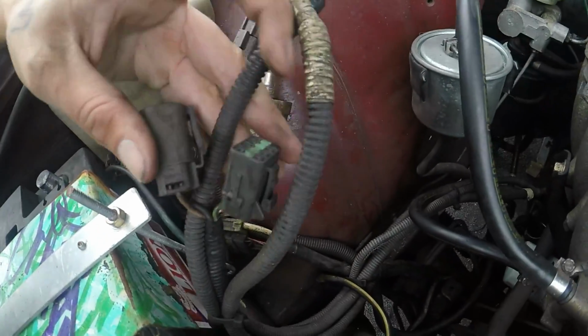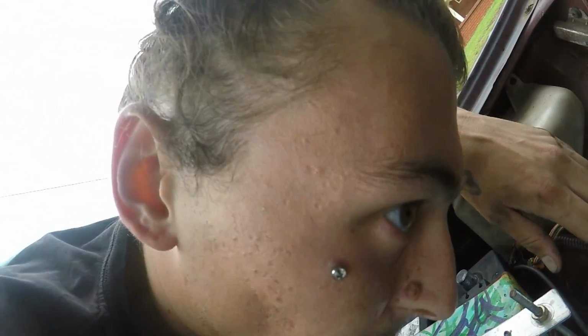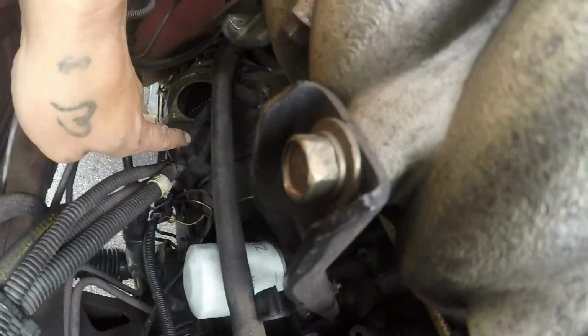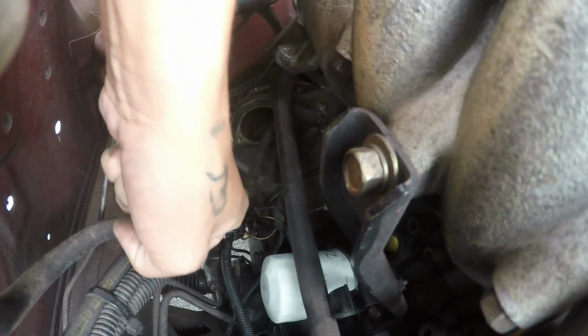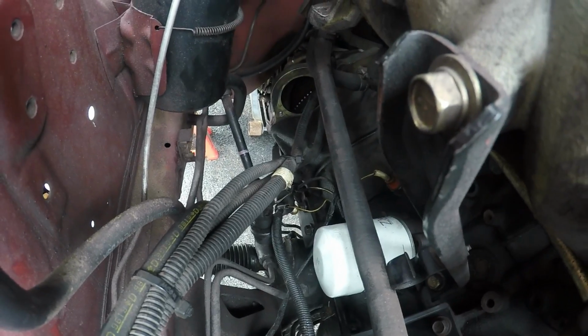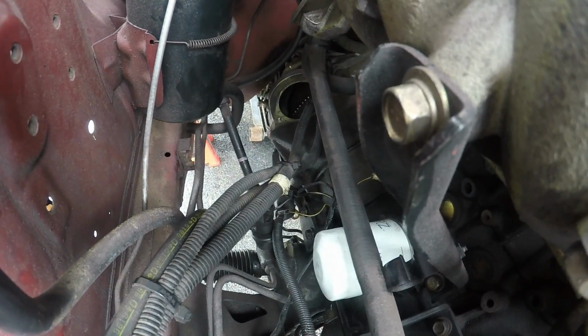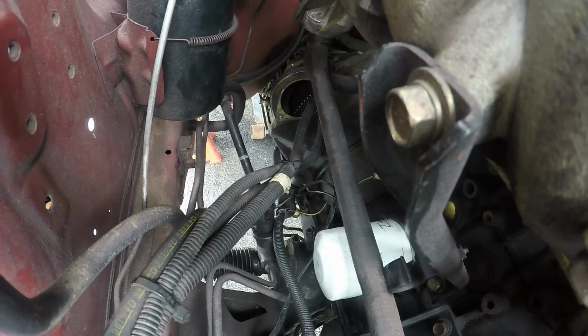This is like the easiest manual swap ever. You just need to find out where these electrical plugs are, tucked away behind your battery. This is actually one of the best manual swaps. Your starter motor, you get from the engine bay. You just get a long extension to get the back bolt, and then you can crack the back bolt first. Do that, the easiest one to get last. It's easy, man. The starter motor comes out in like 5 minutes. We unplugged those gearbox plugs in like half an hour, but they actually only took like 1 minute to unplug.